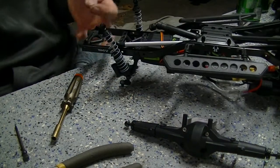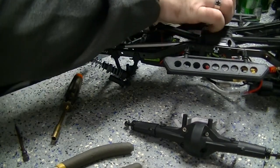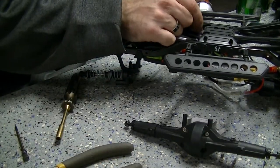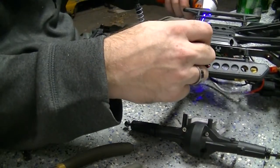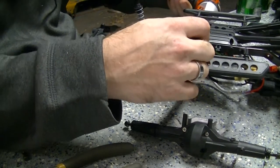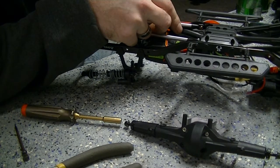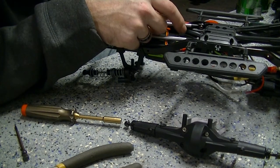I did, however, remove all the hardware at first, then I realized, no, I can use these stock bolts that came on it. I just gotta screw it back in. To make it easier, I found, as soon as you can get a nut started on there, do it, and then just run it all the way in. So now that's on there, and you pry your driver loose. You can attach your other upper link, which, interestingly enough, this time gave me almost no clearance, which is weird, because the other one gave me plenty.